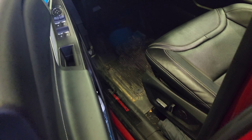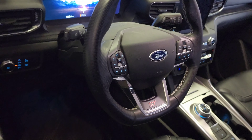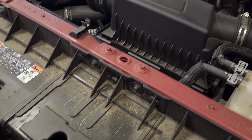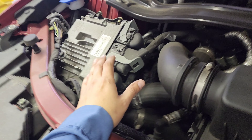Let's do it — how to do the oil change on this 2024. On the title I'm gonna put the generation, from what year to what year you can do this project. Now, to open the hood, you're gonna have to open the door and pull it twice — one, two. This is the European style, like you do on the Minis, on the BMWs. By the way, this car has 34,000 miles. There's no latch here — all you do is lift the hood.